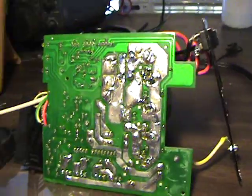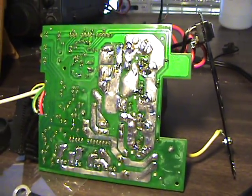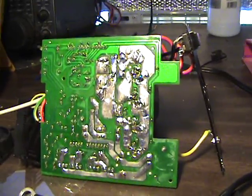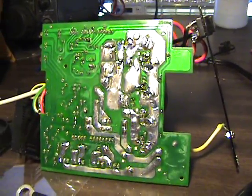There's the underside of our board, and I've measured all around there — there is no short on that board while it's powered off. But you turn it on and you betcha there's a short — you saw it yourself. It appears there's no short on that board until you power it up. There's just nothing shorted anywhere on that input side, but when I powered it up it wanted to draw 15 amps. So it could be something that's breaking down when you power it up, or the control switcher board — that little module that runs those FETs — is switching a pair of them on and not turning them off. Something burned out in there, just keeping those things shorted to ground when you power it up.